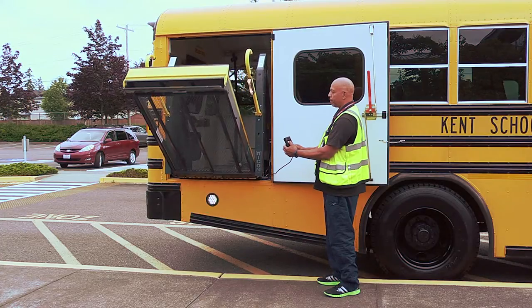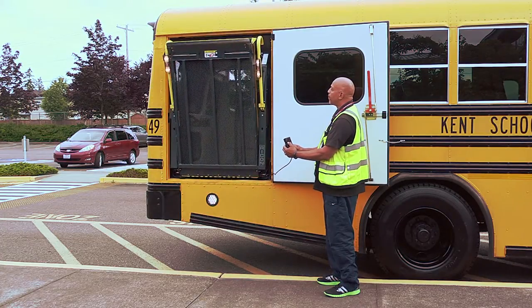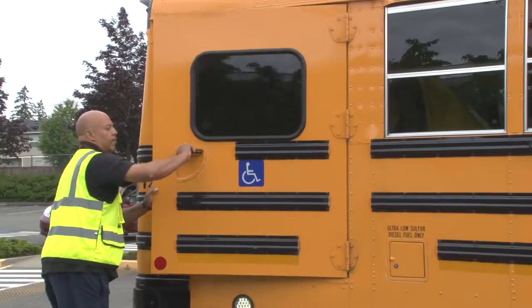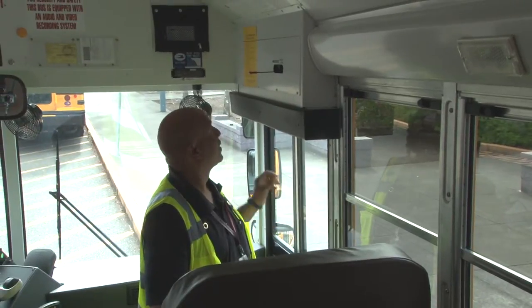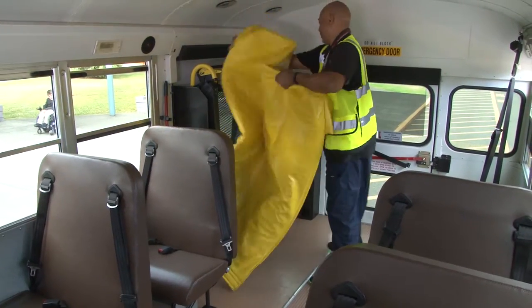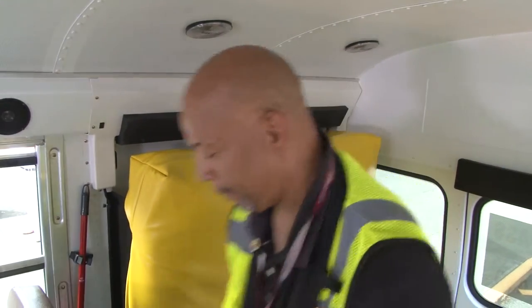Put the safety belt back in place. Store the lift in the folded position inside the bus. Close and secure the lift door. Enter the bus and engage the door air. Close the door and return the cover onto the wheelchair ramp lift.